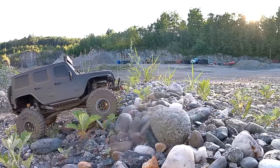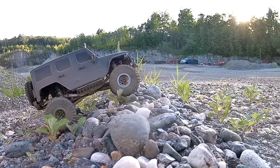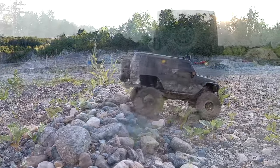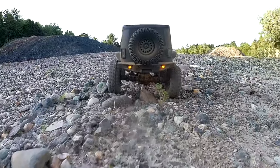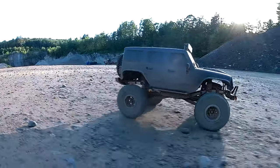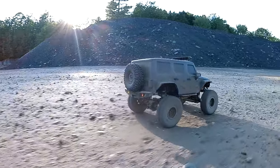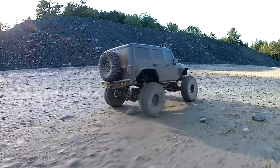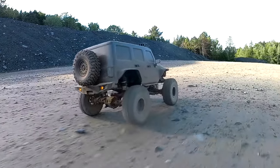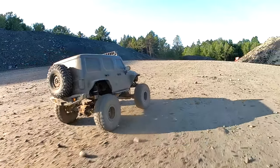You can see that right rear shock just has no give at all through this whole thing — so frustrating. You can see what it's doing as it pushes up over the edge: left side working just fine, right side not at all. The whole time I was looking at it like, oh, I wonder why it's leaning — the shock seems like it's working. I was even stopping and flexing it every once in a while, but no — two o-rings on that thing. Worst idea ever, I swear.